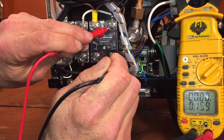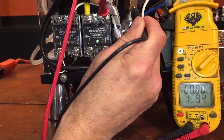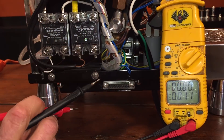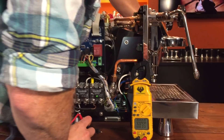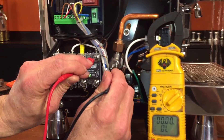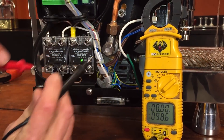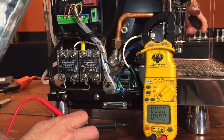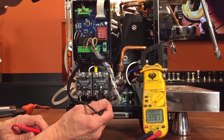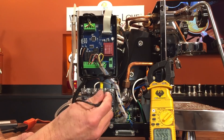Then what we can do is check power coming out — put your red lead there and your black lead over here. It's flashing so it's going to jump around. If I raise the lever here on this side, we've got cold water coming in — see now it's on all the time, so you'll have steady voltage. That's one way to check that. But you already probably know if your brew water is not heating and that light's not on, then you have a serious control problem, and that's not going to be covered in this video.